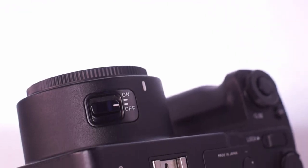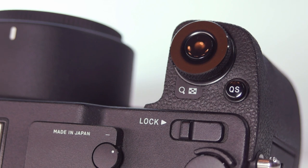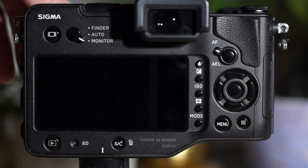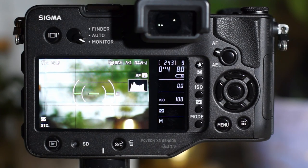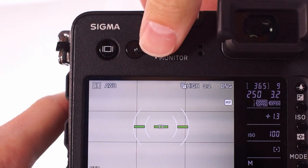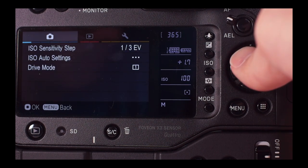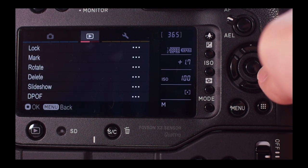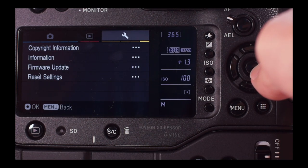Going to the top, we see the hot shoe and the usual controls. The wheels are very firm and clicky, which I like. The lock switch disables the face buttons while still allowing shutter speed and aperture to be changed, which is very useful since the face buttons are really easy to press accidentally. Looking at the back face, you see all the usual buttons. The D-pad is made up of separate buttons — fairly long travel, but they don't really have any real click to them, they just kind of bottom out, which is fine. Toggle switches, on the other hand, are very clicky and feel great. Menus reflect everything else about this camera — designed to not get in the way. They are very to the point and easy to navigate, with three basic sections: photo, playback, and configuration. Sigma expects that if you're buying this camera, you probably know what you're doing, so they treat you like it.